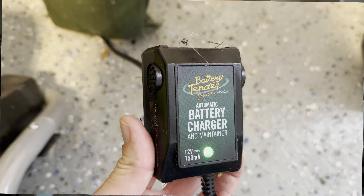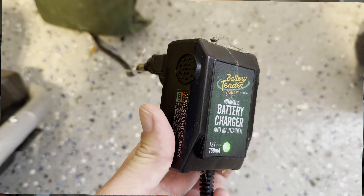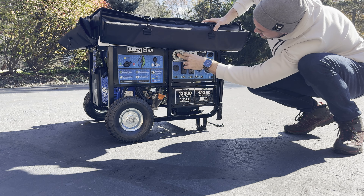I mentioned the automatic start — it works great when it's warmer out, but when it is colder it doesn't seem to work at all. I keep this thing on a battery tender, which is kind of surprising — it tries to turn over but essentially if you're cold-starting it, you really have to use the pull start as a backup. Not the end of the world since it's nice that it even has the push-to-start, but that only seems to really work when it's warmer outside.